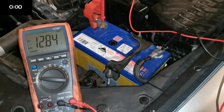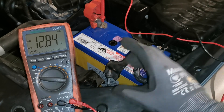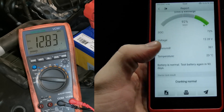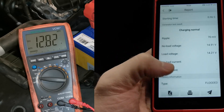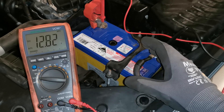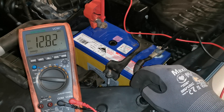That's it for checking a battery using only a multimeter. Multimeters are limited, so a better test will always be using a dedicated battery tester — those can measure internal resistance and give you a state of health, state of charge, and overall battery condition assessment based on the battery type. But if you don't have one, a multimeter check is still very useful and can indicate a charge rate issue or flag concern if voltage drops below 9.6 volts.